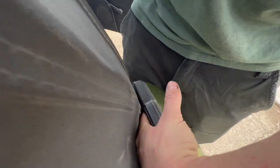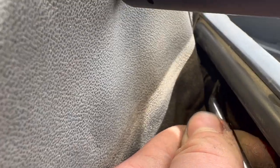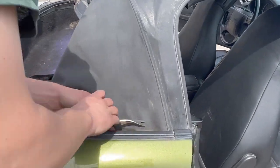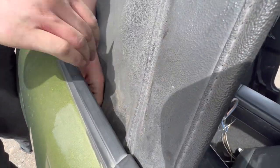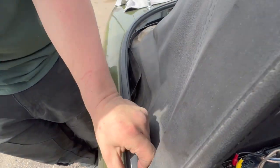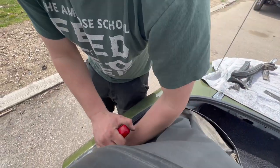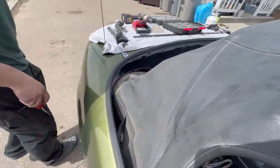It's kind of hard to show, but it's right here at about this seam down — you can feel it. So we're going to get our trim tool in there. Right at about the tip of the tool is where the clip is that we need to remove — it's kind of easier to feel than see. If your rain rail was good and you're wanting to use it, then you're obviously going to want to be a lot more gentle. But ours is junk, so I'm not really concerned. Now it's free — we're going to do the same thing on the other side.